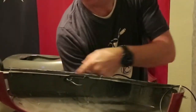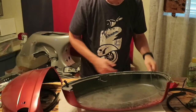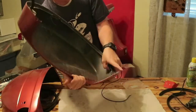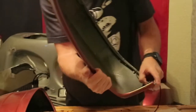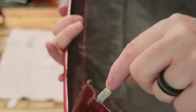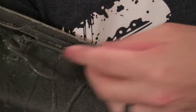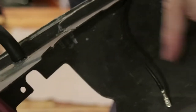Inside here there are these little metal tabs underneath. This wire is going to follow along underneath those tabs all the way back to where the turn signal is. So we dropped the wire in with the contact - the contact and the wire come through the little peg - and here it is running right down behind all these little tabs. You bend all those tabs over to kind of hold it in place. Then this wire runs through here, goes behind the spring retainer, and runs over to where it will plug into the turn signal. And you can see the little rubber piece we put on there.